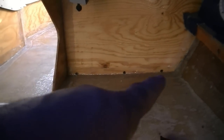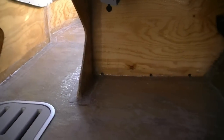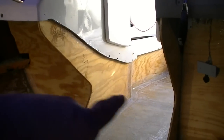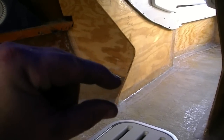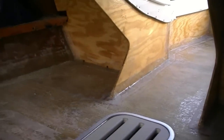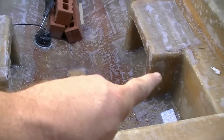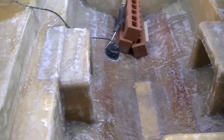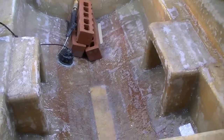Let me show you another thing I did — you see the three weep holes? I did that on each side, shoved resin in there, and we'll put gel coat in there also. I also did it for the seat boxes up front because we got a really big rainstorm and the front cover leaked and dang near filled up that front box. So I created two holes there — it drains into the little storage compartment — and then three holes here. I'm going to get this dry deck rubber mat that has stilts keeping it up off the deck so water flows underneath. I would say we're going to be gel coating in the next couple of days. I want to put a little more tabbing on the engine mounts — I'm going to tab into the stringers and tag into the hull with one more layer, and come out a little further just to give it a nice final coat.